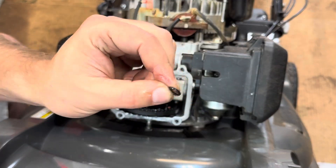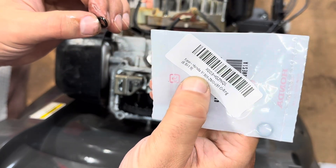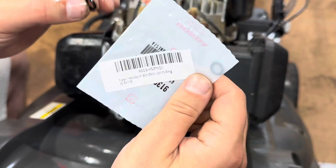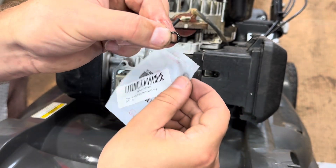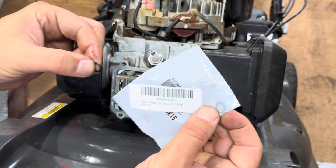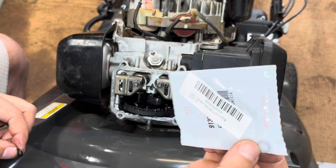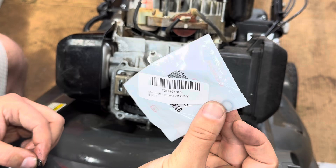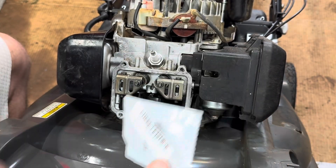There we go. You can feel this o-ring getting pretty hard. Here's the new one — the part number is 91301-ZM0-V31. You could probably try to match this with one of those o-ring kits, but I'm not going to risk it. I don't want to get something too small or too big and have this thing come back with another oil leak and waste my time to save six dollars. So I ordered the correct one.